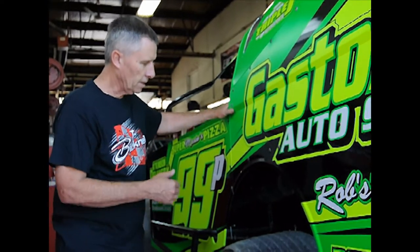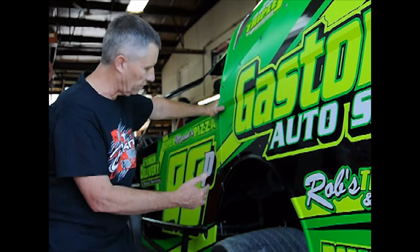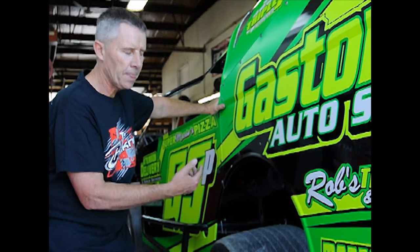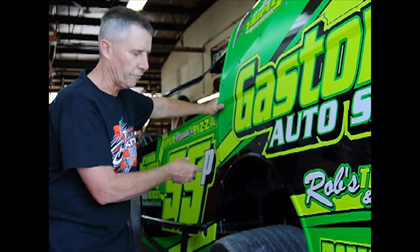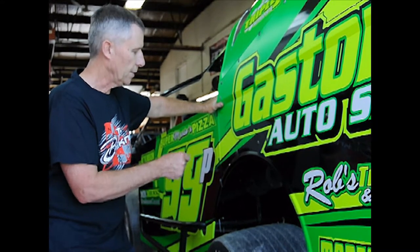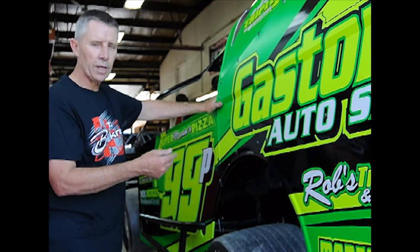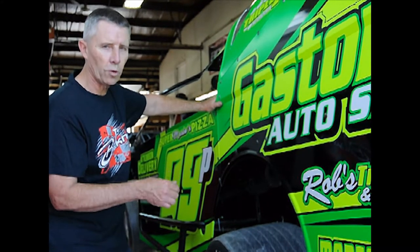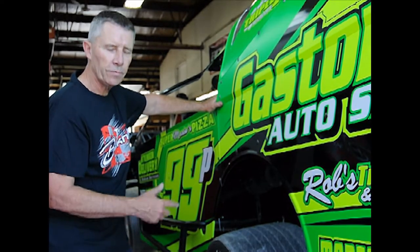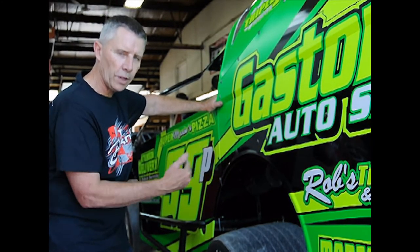After that, we come to the back end. It depends on the race car itself and where you've got weight naturally. With big box cars that have left side oil tanks or left side dry sump tanks, achieving that left side percentage is very easy. Cars with heavier engines up front — like big block setups — may have limited rear percentage and struggle to reach the left side percentage we normally need.